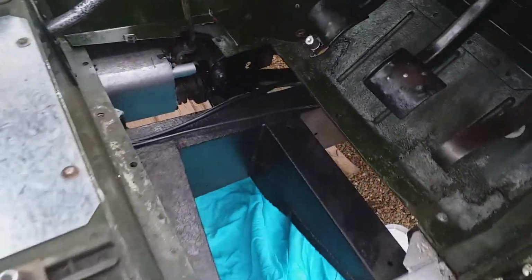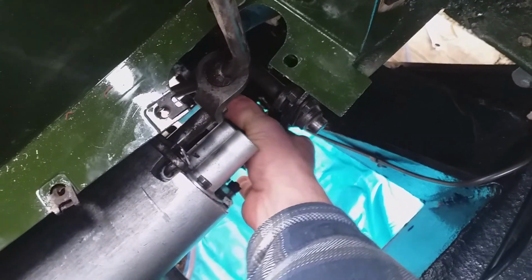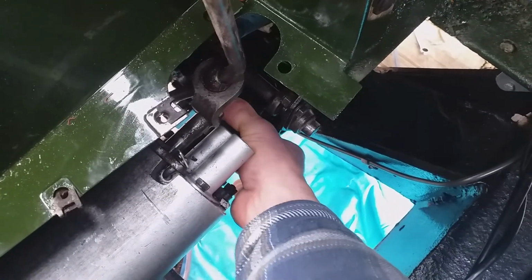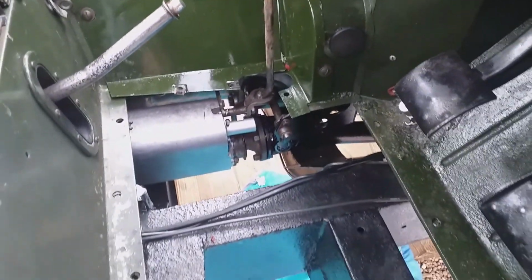And what I'm doing is putting the front prop shaft in. And well, I've just had a massive issue, there's a panic over it. It was actually still in gear. Alright, so that's a pretty schoolboy error. Just not used to it. So I've got it turning, it's turning nicely now, so I can get back underneath it. Didn't need to move the floor. That's one of them things. I've also put the high range and low range lever in the neutral position.